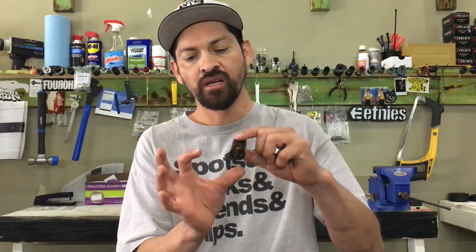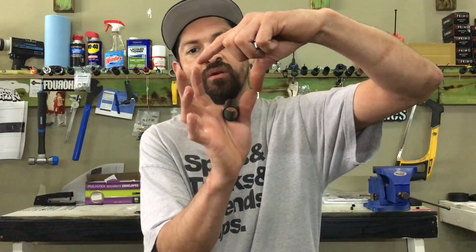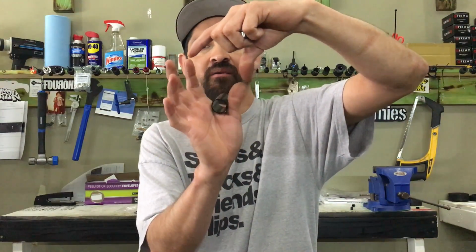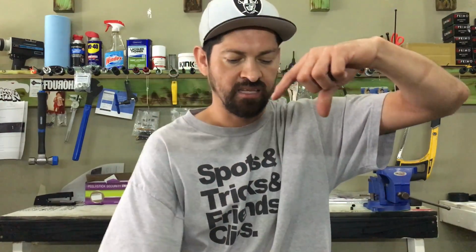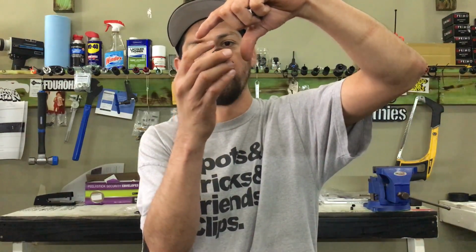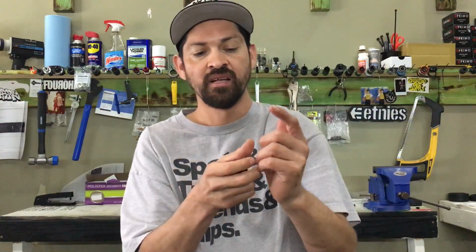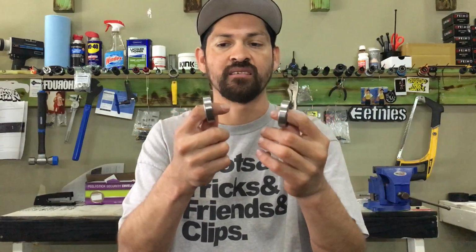If you look at a sealed bearing, there's a race on the bottom and a race on the top. So the bearings run really, really strong up and down this way, but when you get the side load, you're kicking it like this, kind of like kicking the side of your kneecap. It puts pits right here and right here when it gets pushed up against it. That puts a lot of load on your bearings and jacks them up.